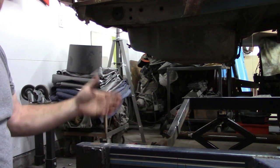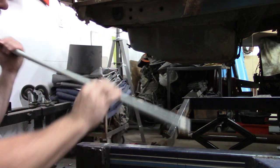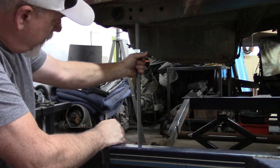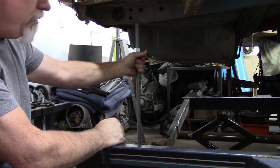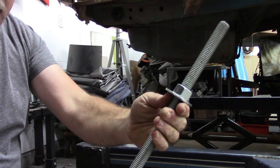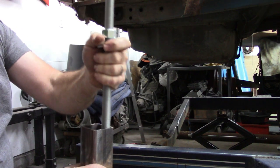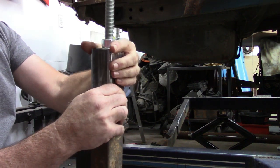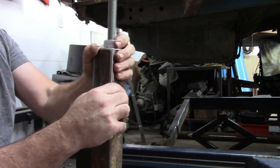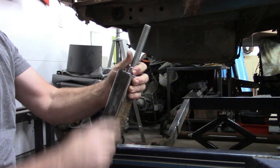I have limited space so I'm just trying to give you as much of a view as I can. If I use this three-quarter-inch all-thread, it'll go right up in the jig location. There's a little bit of play there but it goes up into the hole. At this point I just have a nut on the all-thread and a thick washer, and this will basically get welded to the top of the two-inch square tubing. Then I can take the all-thread and turn it up or down as needed to give me more clearance — I can thread that into the tubing itself.